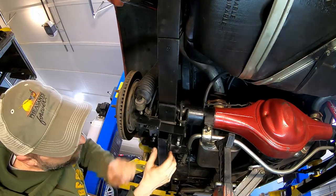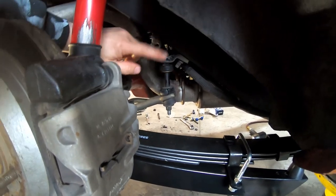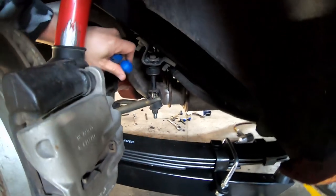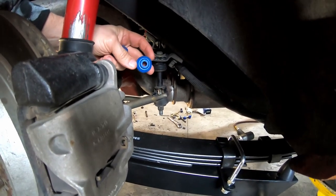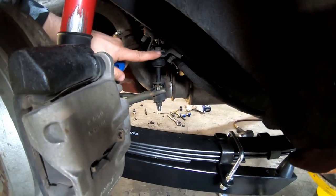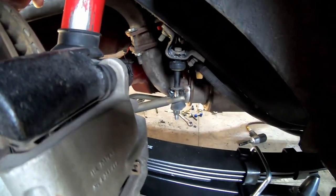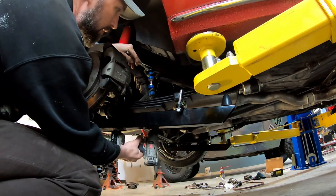On this car I've got an aftermarket sway bar assembly — also a Vet Brakes and Products component installed about 15 years ago. The plastic on this is just completely gone. I ran down to my local NAPA and picked up a couple of these made-in-USA bushing pieces — this actually fits like a front sway bar link on a 1980 Camaro and fits a lot of different parts — about 15 bucks. You have to jack up the axle and take the pressure off to get in there and replace it. Thanks to the magic of television, suddenly this bushing is replaced.